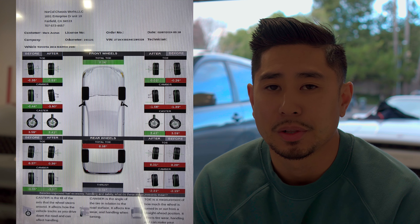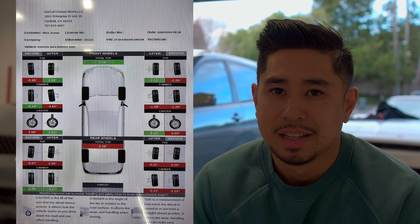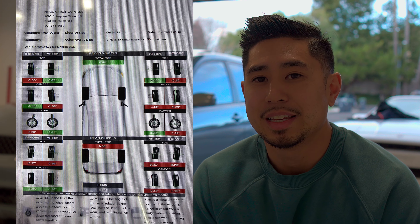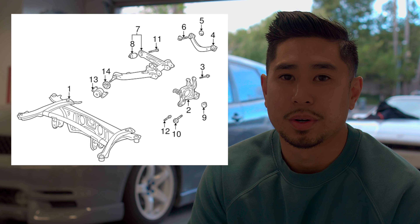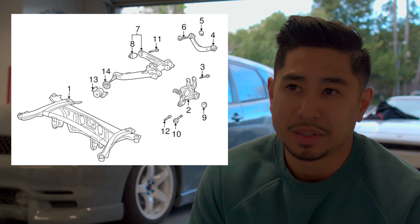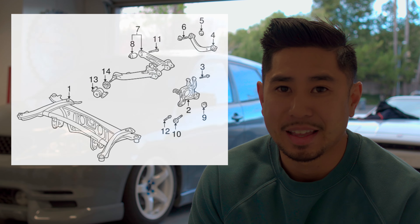The ultimate goal is to get independent rear suspension on this thing — by way of either a 1999 through 2003 Celica GTS, or ideally a 2004 Matrix with four-wheel drive that has independent rear suspension. It's not a direct bolt-in swap, but I'm willing to learn.